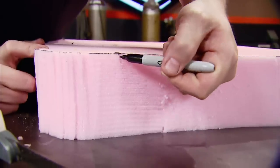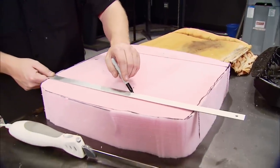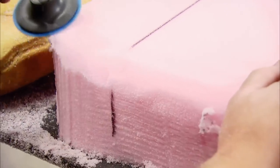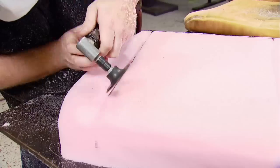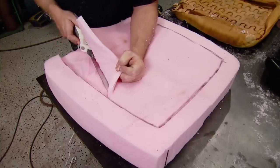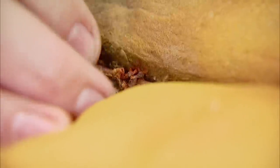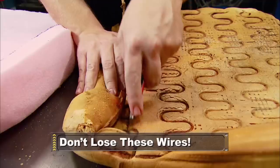I'll draw some lines that will tell me where the creases need to be on my new foam, then start sculpting it with an air grinder — Michelangelo, step aside. You don't need a really aggressive disc to do this; it's foam after all. I'll grab my electric knife again and use it to fillet out the bottom of the piece where the foam sits onto the frame. Then I'll clip off the rings that hold the wires in the old foam and cut out the ones that are molded into it.